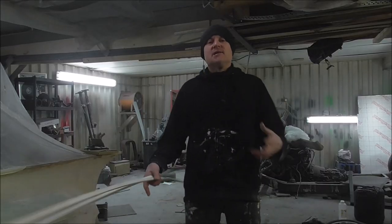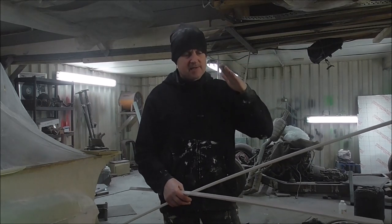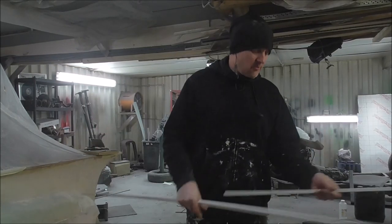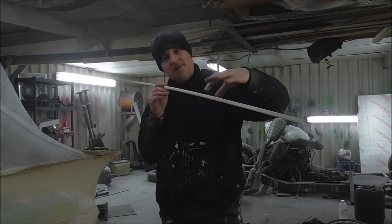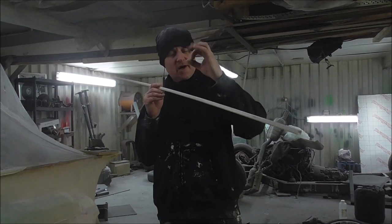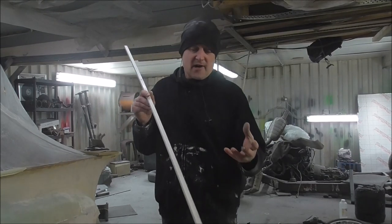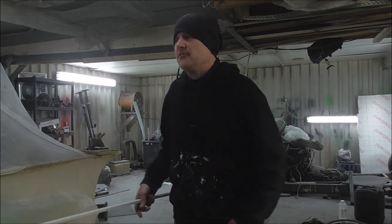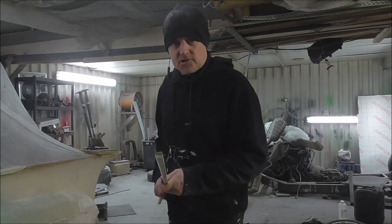Okay, so bracing fiberglass. I'm going to brace that bonnet around, so I want it to be really, really stiff. Don't want it flapping, want it to be stiff. So I'm going to brace it with this, which is super flexible. But what you've got to think is I can stick this on with some Bondo, and then when I go over it with the fiberglass in two layers, this just holds the shape of the fiberglass. Because that makes that tube-like shape, that's where I get the rigidity, and it's a lot lighter than making a steel frame. And also, it's a bonnet, so it's got to be quite light. You don't need four blokes to try and lift the bonnet, do you? So, I'm going to stick this on, thin glass over it, and we are one step closer to the 60s truck bonnet.